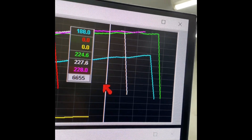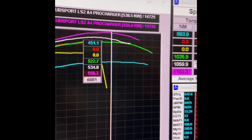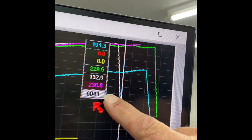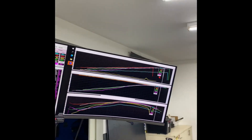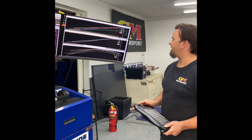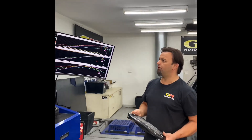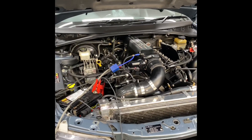Going back over here — there are the boost figures, about 224. The Procharger keeps rolling and keeps going, as I was talking about. Peak power is about there — showing 555 rear wheel kilowatts — and power's dropped down to 539, but the boost continued to rise because it's belt-driven and the Procharger ratios keep it going. That's what we fixed in the timing table — doing our own segments for that. The injector results don't lie either — we hooked it up live and we're out on the injector, so it's good to have live data with no guesswork.